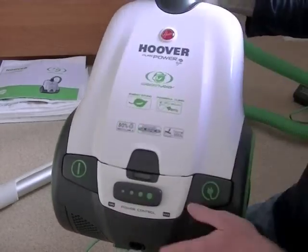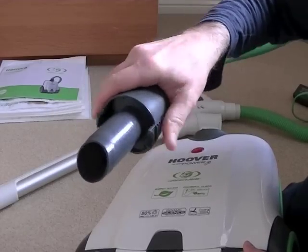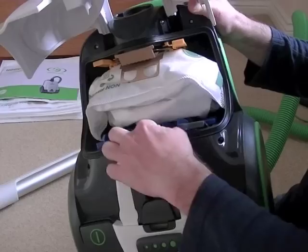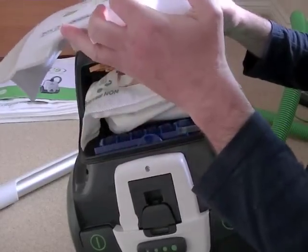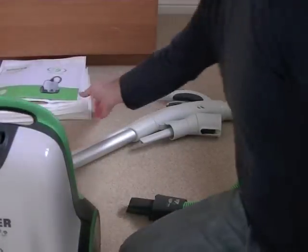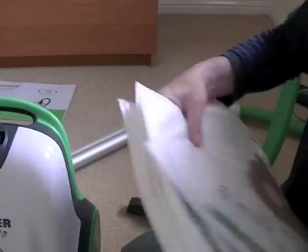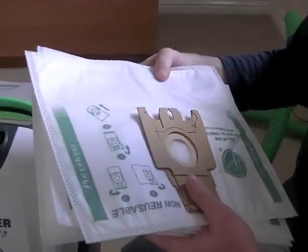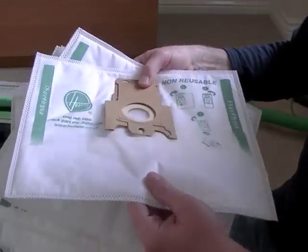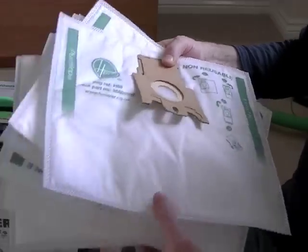Inside is the bag, and to access it you need to remove the hose — you've got two levers either side, just squeeze those and the hose comes off. Then press the button here and you've got access to the bag and the washable HEPA filter positioned behind the bag. You get a year's supply of dust bags with this machine — Hoover think a year's supply is eight bags, so you get seven bags spare plus a bag fitted to the machine. These are Hoover's pure HEPA filter bags — they actually seal themselves when you remove them from the machine, so if you've got allergies this is a very good machine to go for. The dirt is sealed inside when you remove the bag, and you just dispose of the whole bag hygienically into your bin.